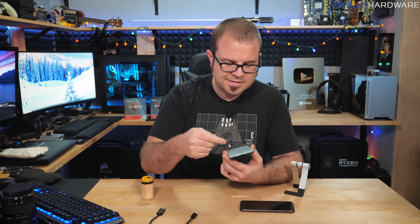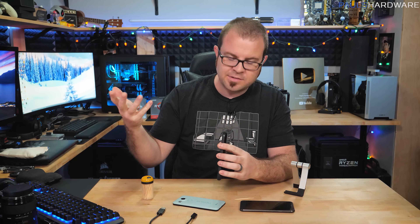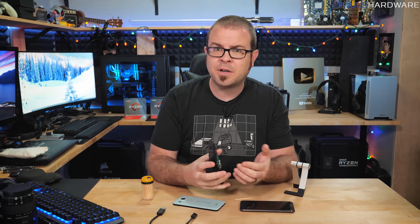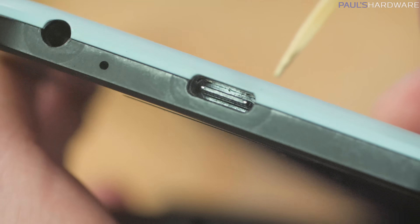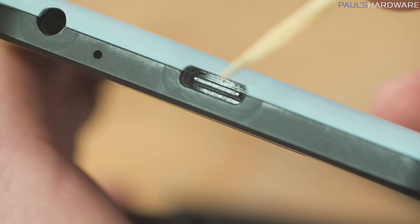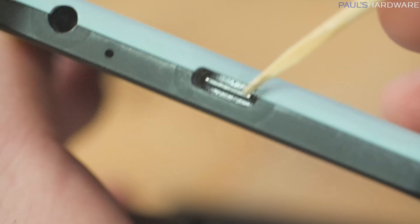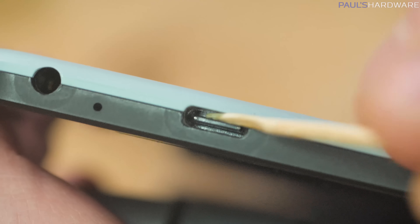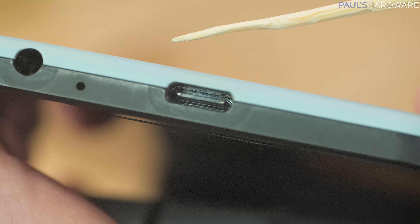So I've got my wife's old Nexus 5, and we'll see how dirty that port got. And then we have one more potential victim — this is Joe's phone, which is an older LG model, and it has a micro port on it. Even though these are becoming slightly outdated, it's still a port that many phones use. Starting out here with my wife's old Nexus 5, which honestly doesn't have too much gunk down in the slots, but it still provides a nice example of what to do. Here you can get a pretty clear look at that center post that goes across the middle. It has contact points on either side, so bear that in mind — they're on the top and the bottom. That's why it's a reversible port. And here you can also tell that my toothpick is just barely fitting down in between this groove and that center post, and that is with the toothpick kind of shaved down a little bit.